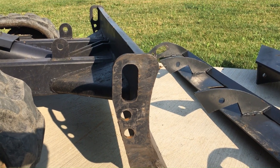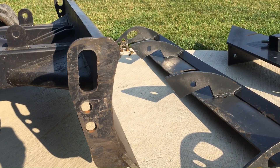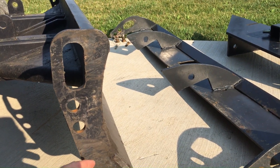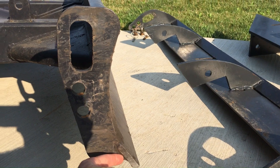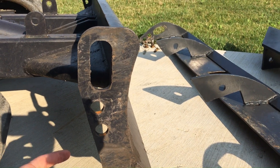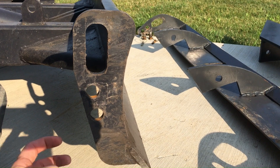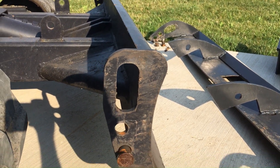What I did is I started out by taking a piece of plywood, held it up to my plow blade, and I accounted for this piece here where the steel sticks out. I basically traced all of this line here, and I knew I would need to have a way to take it on and off easily, so I had to add some holes for the pins to go in and lock everything together.